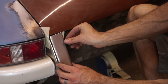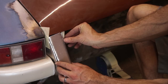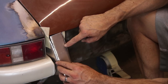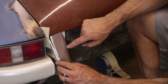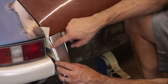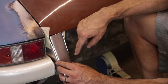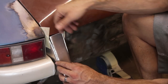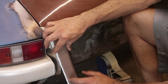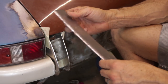This is the rough fit-up with the curves. This curve blends into one and then it'll get welded on the edges. Still some filing to do, still some shaping before welding, but this is the rough width and position on the car. Obviously trimmed on top, shaped so it fits the deck lid, and this is going to get bent as it gets welded all the way around. That's the idea anyway. It's turned out to be a pretty complex piece.